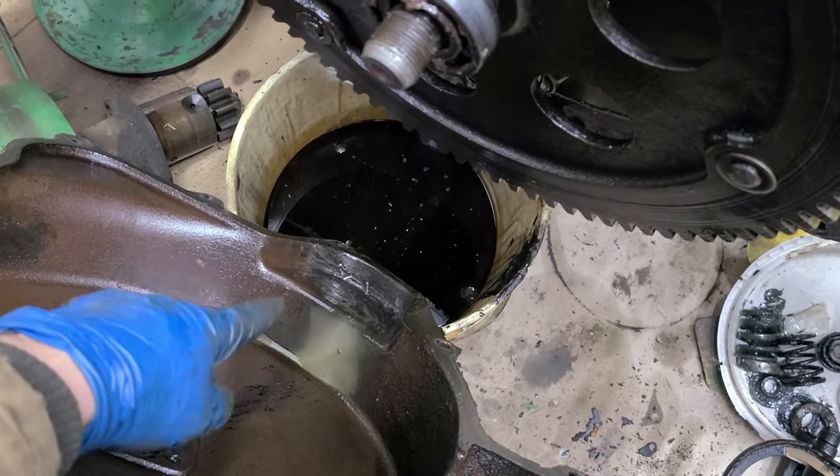Now that I finished that clip, I realized what went into the bucket — I think it was the spring for the camshaft. There's a spring that goes in here and rests against the camshaft; it somehow worked its way down and fell in. Note: don't lose that and don't forget to put it back later. Then I had to use a puller to get the bearing off, and another puller to get the gear off with a lot of tension. I ended up hammering on the end of the puller with a sledgehammer to break it free.